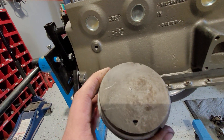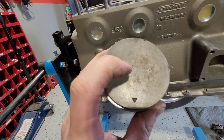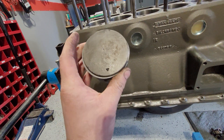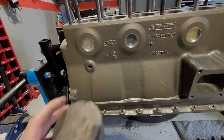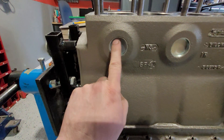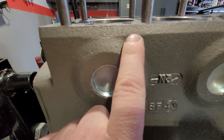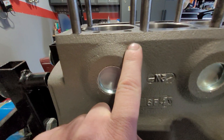But how do you know what was in what? If you've taken these off and the stamp was worn off and you don't know which one came out, what you can actually do is look at the engine block. Just here on number six, if you look carefully, you can actually see the stamps. And this is on every block, the piston is not worn down.